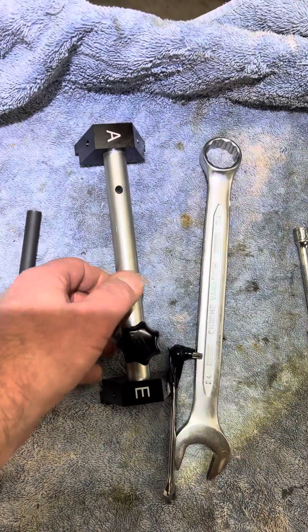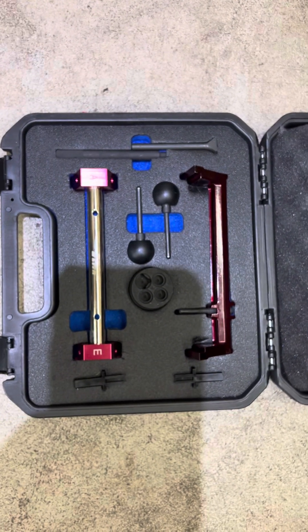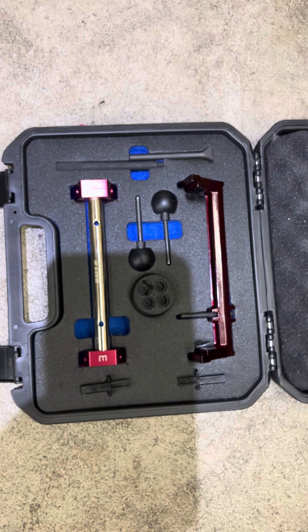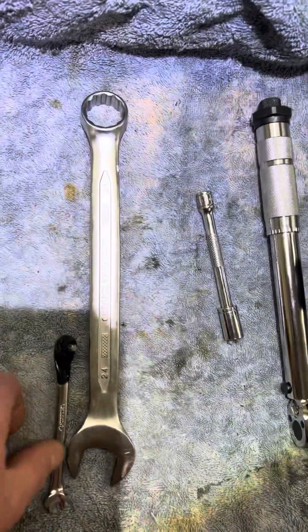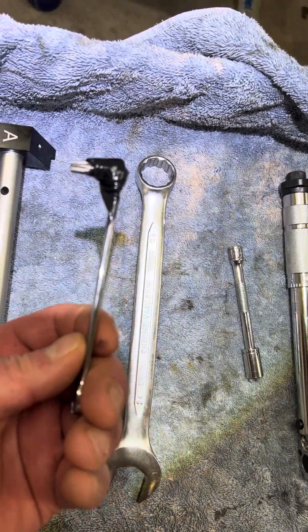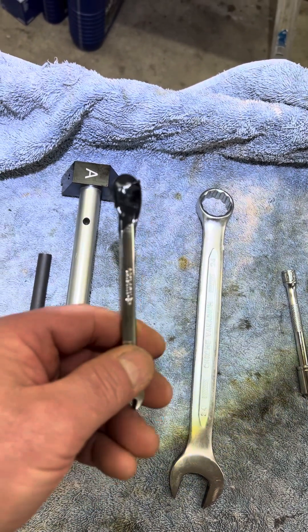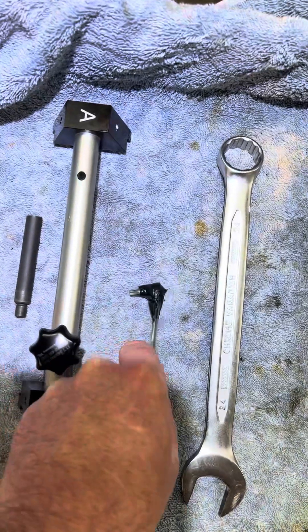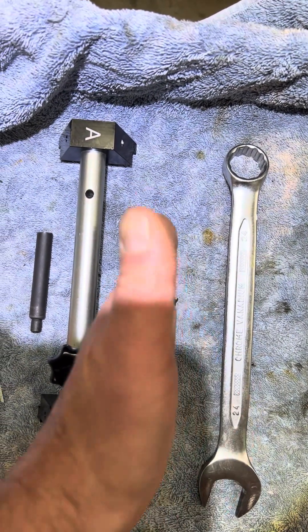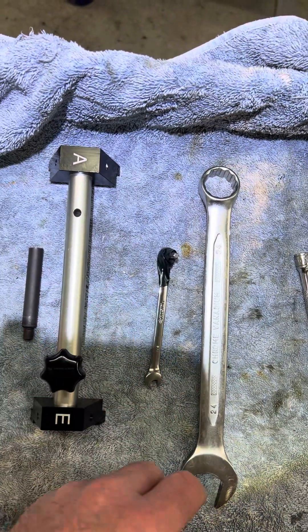This is just a pin — you should be familiar with this if you're thinking about doing this job. The BMW bridge: don't use a generic one, I made another video about it — it's not accurate, it's close but I don't recommend it. The tool I showed you to get the Torx bolts off the caps for the Vanos — you may be able to buy a Torx bit that fits, but I made this custom one, and you could even cut it shorter with a saw. This gives you enough clearance to take the caps on and off with the Vanos in the car.